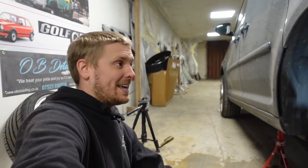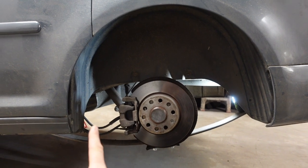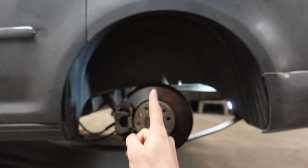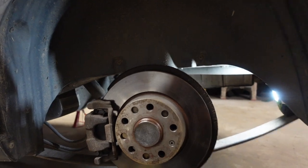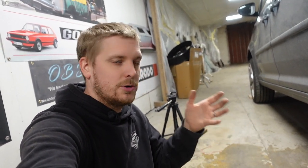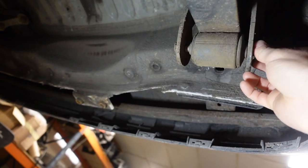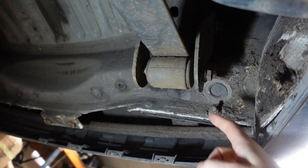If you look at the driver's side, you can see the leaf is on top of the beam on that flat plate. On the passenger side the leaf is now on the bottom — we've moved it from here down to here using these plates. There's a nice little round that puts the axle into the correct place. Sometimes you have to put on an actual relocation plate. I've been kindly sent these by Forge Motorsport — I'll put a link in the description. They advise fitting your suspension without them first just to check, so that's what I'm going to do.